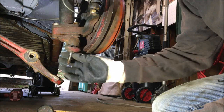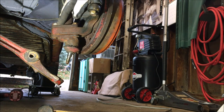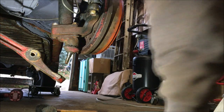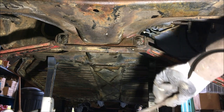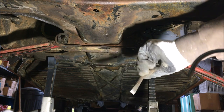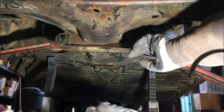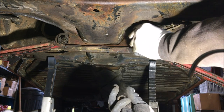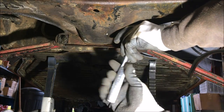I can feel it — that's why I'm changing all of it. It's easy; you only have three bolts here on the '71 to halfway through '73 — just got three bolts, ball joint comes right out, no pressing, no nothing. Let's get this lower control arm off. I marked it with a punch so I can put it back to where it was, and I'll still get a front end alignment. You definitely want to mark them because you want to get them as close as you can to where it was on the road.